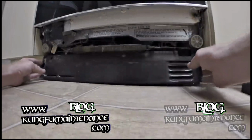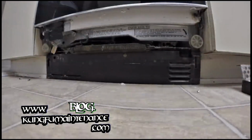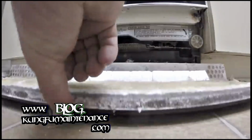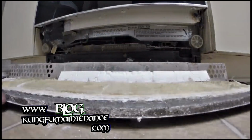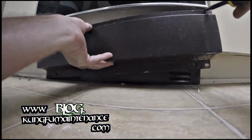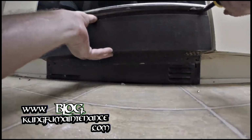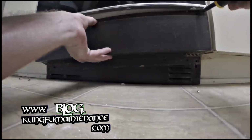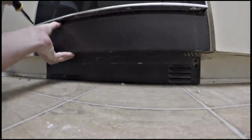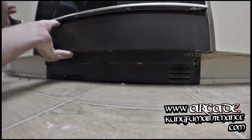Now I can put my covers back on. This one probably needs some cleaning, but you know, it is what it is. Anyway, at least it'll drain now. I'll make sure everything drains properly. On some newer brands, when they sit empty for a while, this just happens. The impeller freezes up and gets stuck. And it happens to the old ones too. Job security.